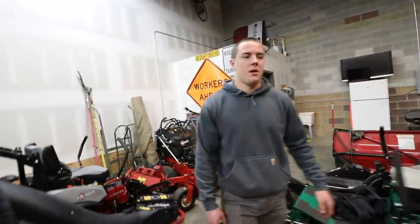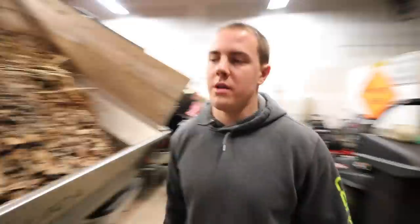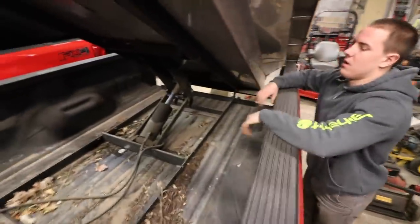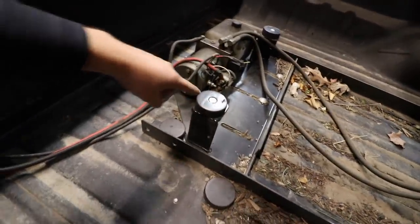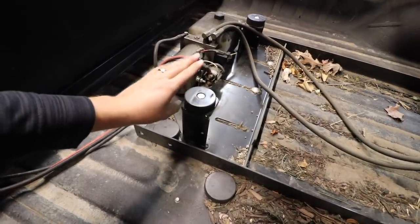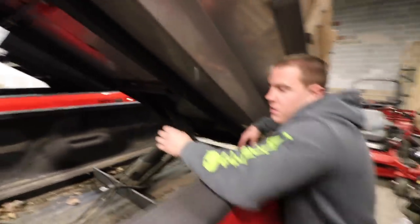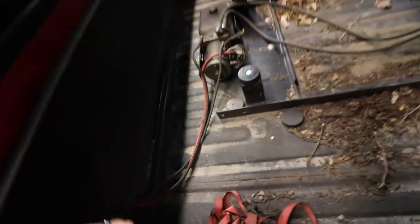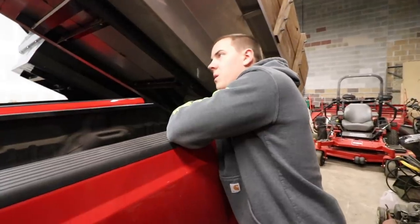You want to talk about mounting yours, because you installed yours yourself? Yeah — the buyer pretty much slid it on my truck bed and said here you go. So I had a ratchet strap to get it home. When it's in the bed you can kind of shake it around to get it where you need it. One thing I still have to do is these little mounts — just a little bracket — where the dump sits down on these can kind of wear out. They'll wear right out. After about six months, the little bushings that were there compressed.